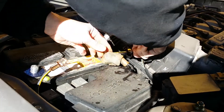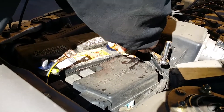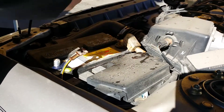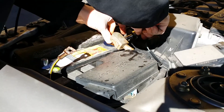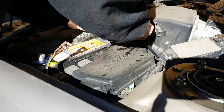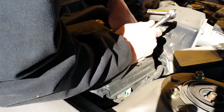You can see here we had to remove the post to remove that felt washer because the terminal wasn't getting tight - it needed to sit at the bottom of the post. So watch that when you put these little felt washers in, otherwise you'll be back to square zero. You won't make a good connection if the terminal is loose. You want that terminal to be tightened on there really snug - not too much, but really snug.